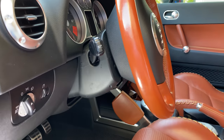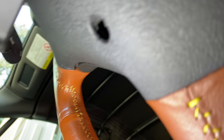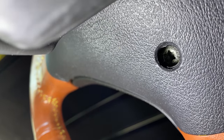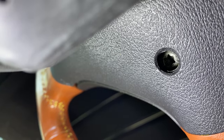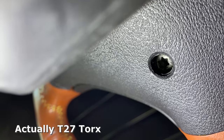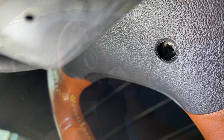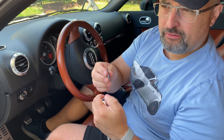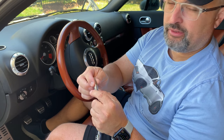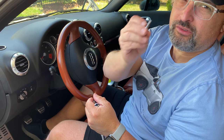Let's get on with the steering wheel. The first thing you need to do is remove a couple of screws that are sitting just behind the steering wheel. I think you can see there — it's a T30 torx. Actually, I said T30 before but it's not a T30, it's a T27. That's the one you need for the two screws behind the steering wheel — T27 torx. There's one in the bottom and another one at the top, and those will get off the face plate so you can disconnect the airbag.